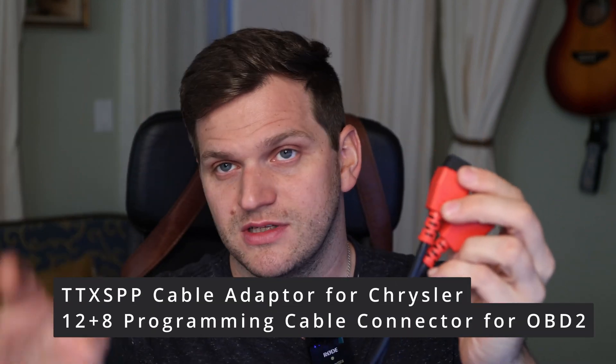Additionally, you need to get a wire — everything is linked in the description below. In combination with the OBD scanner, you plug it in and it gives you two more inputs. There's a picture for my Jeep Wrangler, also linked in the description, showing the wiring scheme. You need to connect the security gateway module to this adapter so it can change settings. This step is very important and must be done first.